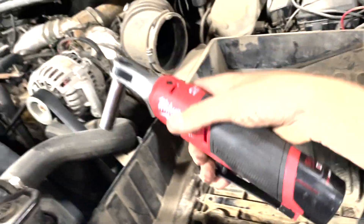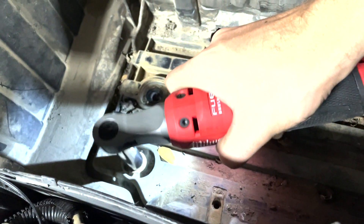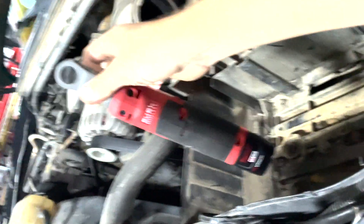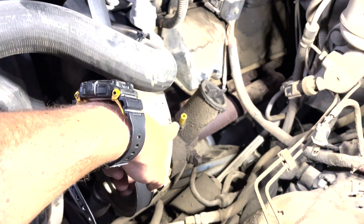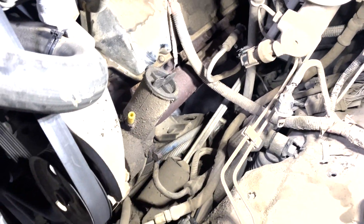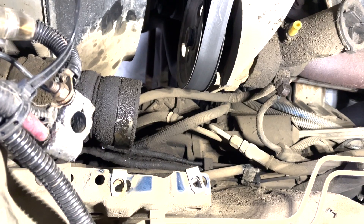We're making some progress. Got the air box out and the battery out. I'm using this Milwaukee Fuel 3/8 driver — if you do a lot of automotive work, highly recommend it. Just busts these nuts free; they've been in here for who knows how long, a lot of torque, fantastic little tool. We have the air box out, the intercooler line is detached and out, and the power steering return line from the hydro boost is off. You can see that's the box down there that we've got to change, with all those lines coming in and out of it.